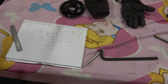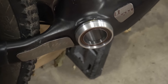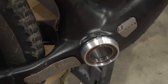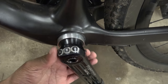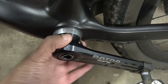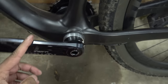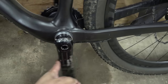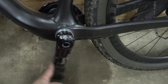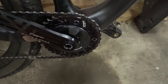When you actually clamp it up to the max you'll get a bit more compression than just by hand. There's a bit of play in there and that's been engineered — it's a gap there to allow you to put the preload on. Just turn it over and that play is gone. That will now go into the bike. The bottom bracket is in — I won't show you the six minutes of pushing it in. The bearings are all smooth. We put the crank in, there's a bit of play in the spacer because we haven't done the preload collar up, so we just do that up to take the slack up and away we go. Full seal bearings so they won't spin as freely, but it's a mountain bike so that's to be expected. Spun it a couple of times and it seems fine.